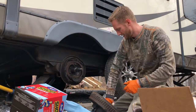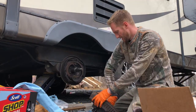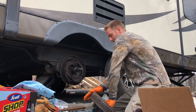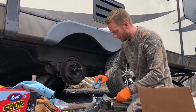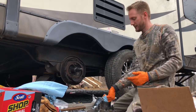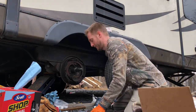Make sure you've got lots of rags. If you've never done this before, you'll be pretty amazed at how easy it actually is. It's a little time-consuming just because you're cleaning stuff, but it's not hard — it's not strenuous, anybody can do it. There's a lot of grease in there — there's a little reservoir that holds the grease for the bearings so that as they heat up, the grease can move and expand and keep your bearings nice and lubed. That's where the brake cleaner comes in.